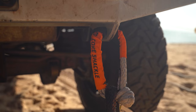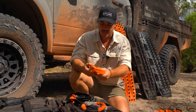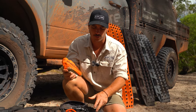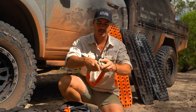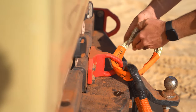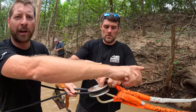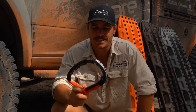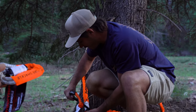Next on the list we're talking shackles. Basically these are a replacement for your old school D shackle, which was essentially a deadly flying object if anything went wrong. Your core shackle is super safe, super strong. You literally slide that one out, the big knot goes through the other end and that will tighten up. Your core shackle is the stronger of the two — you'll use that between your kinetic rope to join multiple ropes together, or around your static rope on your winch ring. Your fuse shackle — fuse for bang — is literally the weak point of your whole recovery setup, so it's super important to know where the weak point is so you know where to put the dampener.